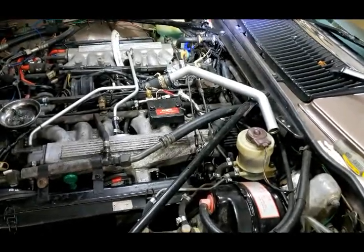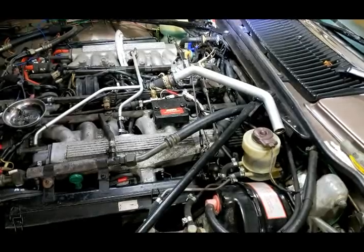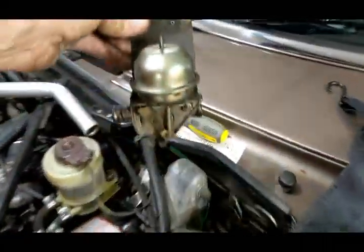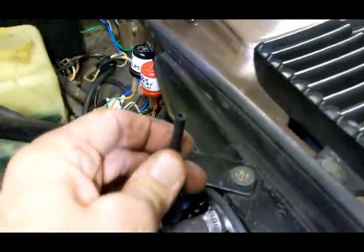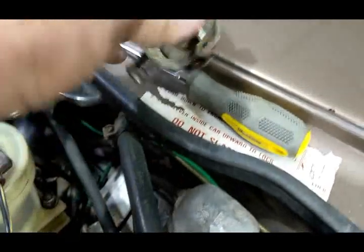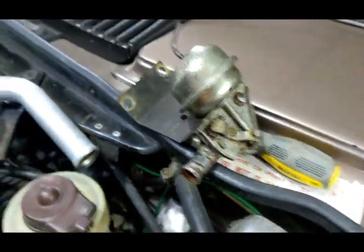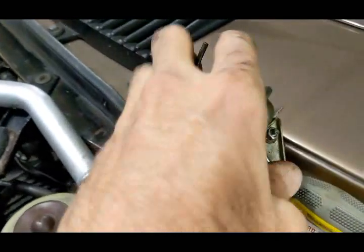So I checked in situ — I checked the water valve, which is this device here. I found a few things: first of all, I was getting a vacuum from this supply, and when I applied a vacuum to here this valve goes up. I'll show you that. Anyway, what was happening is it was sticking.